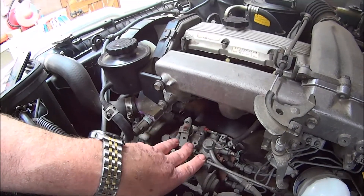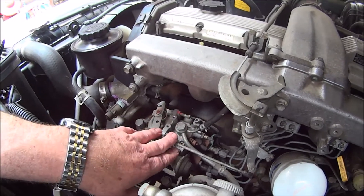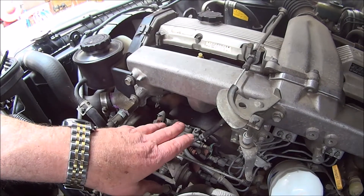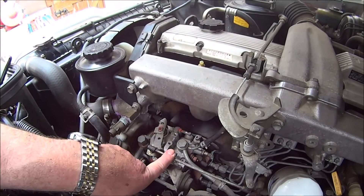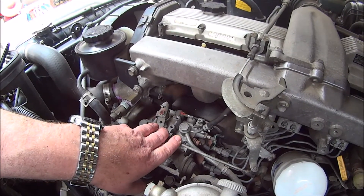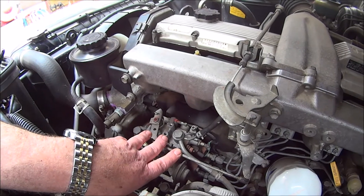In this case it has a mechanical fuel injection pump. You may have a big block Mopar V8 with a large Holley carb, or perhaps a newer engine with computer-controlled fuel injection — but they're all fuel delivery systems. You've changed the vehicle from standard manufacturer specifications to something else, so you've got to change and tune the fuel delivery system to suit the new condition in the engine. Don't assume you know more than the manufacturer. These tuning modifications are reasonably complex and probably best done by specialists.